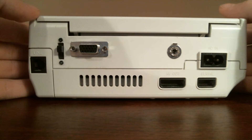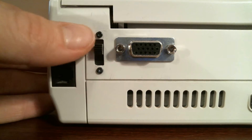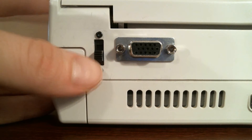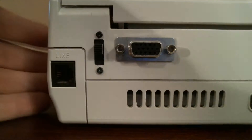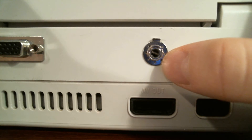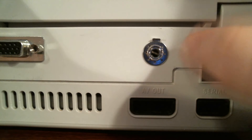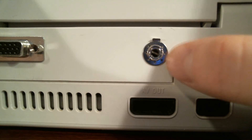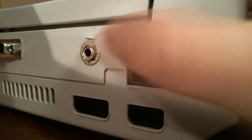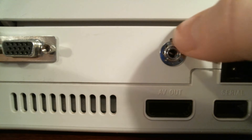This switch frustrates me a bit. If you look closely, it's not as neat as I hoped — when you flip it up it's not completely flush to the edge, there's a gap, and the same is true when it's down. It's a little frustrating but something I'm willing to deal with. Also, the hole I drilled for the 3.5mm jack was just too wide, so it would poke through. I found a washer — it's the only one that works, though it has some holes and a bent part, so I was hoping to make a hole to mount it the other way.